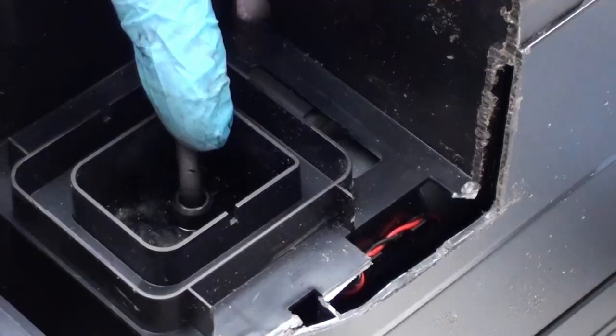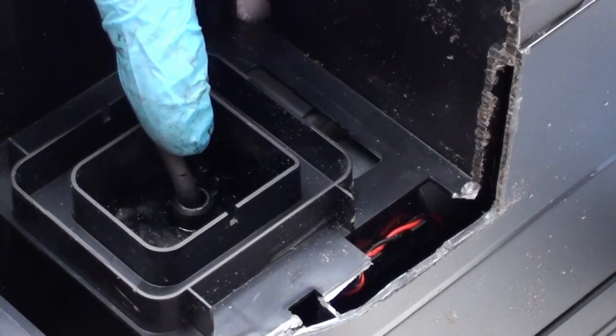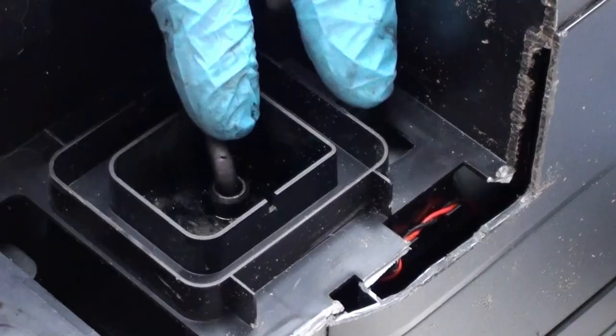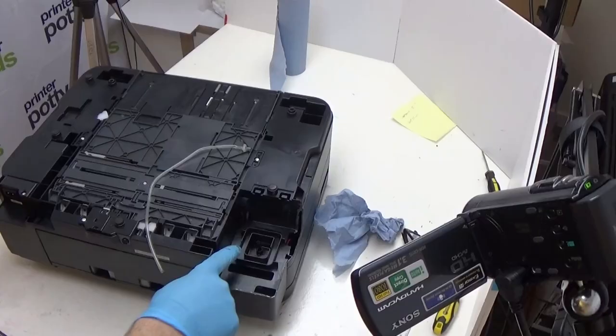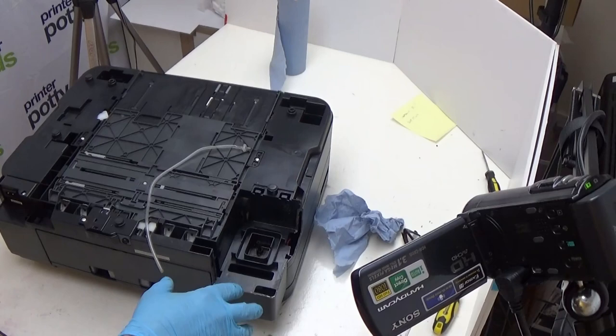If you look here, there's a split in the bit of tubing. That's from doing multiple takes of this entire process — this tube has gotten a little nick, a tiny cut above where I've been clamping with the forceps. Repeated clamping does cause that unfortunately. If you have this scenario where you have a split, one choice would be to stop and go to plan B: replace the waste pads instead of fitting a printer potty. Even with the split, pads would still work absolutely fine.